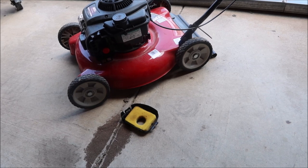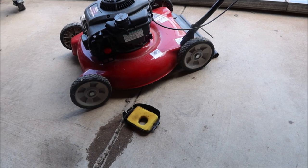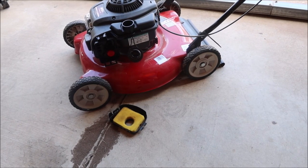Since I know it'll actually crank and run on a fuel source — and guys, you can do this at home if you get one that's not starting, sometimes you can give it just a little help through the carburetor with some carb spray and she'll crank right up — let's go ahead and see what's going on with this carburetor. The first thing I'm going to do is empty out all of the old gas that's in the carburetor and put some fresh gas in the tank.